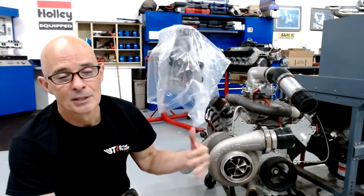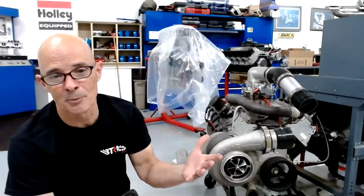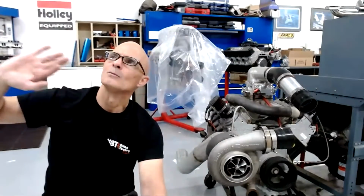Can you give a quick overview? It's a really long thing. We're talking about horsepower per PSI, and the best way to change how much horsepower your turbo provides per pound of boost is to change the power output of the NA motor. So if you have a 300 horsepower motor, you're going to make 20 horsepower per PSI. If you have a 450 horsepower motor, you're going to make 30 horsepower per PSI. And a 600 horsepower motor, you're going to make 40 horsepower per PSI. That's the best way to do it. And having the double wazoo turbo is not going to change that much. You can change it with really, really cold air, though. If you can get your charge air down below 0, then you can make some surprising power numbers.